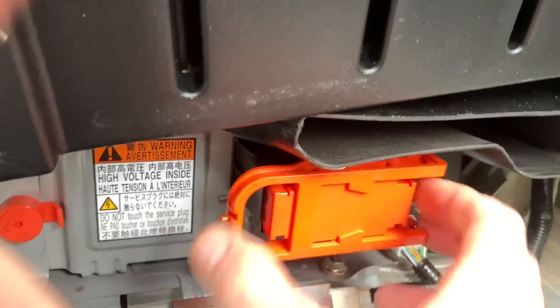And then lock it into place like that. So I thought the battery was dead. I was convinced that since the car has 210,000 miles on it, the battery's dead and it's going to cost me $1,500 or $1,000 to replace the big battery with a remanufactured one. At this point I had replaced the 12 volt and was trying to figure out codes to further diagnose it without just assuming the main battery was dead. I kept reading and was thinking there was something else I could figure out. Long story short, I was reading through the forums and saw someone talk about the gas gauge being faulty on the Prius — that's how I figured it out. I was thinking about that long road trip: I put 500, actually 550 miles on that tank.